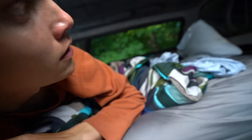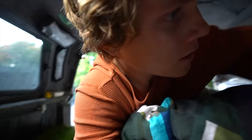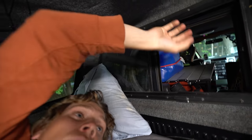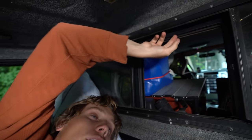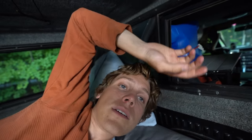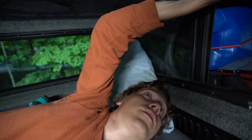This is just a cargo net I put up — I've been getting a lot of questions about what I mounted it to. My roof rack had tracks that mounted onto the topper, and those tracks had screws that came down, so I just utilized those to hang the cargo net. Also, I did end up breaking my back slider windshield. The way I fixed it was I completely made my window a pass-through using a bike tire — a 16-inch bike tire. You can see there's a little filler nozzle right there; you fill it up with air and it seals off the truck.